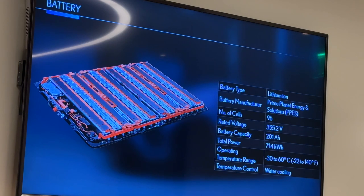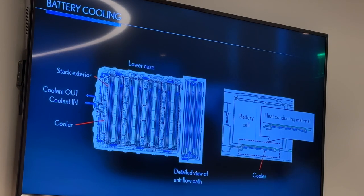A little bit about battery specs. We have a lithium-ion battery — 96 cells in 71.4 kilowatt hours. It's going to be not only water-cooled, but also have refrigerant lines — refrigerant and water-cooled through the case. That case is going to be bolted underneath the body, providing a significant increase in body rigidity, which leads to a very fun car to drive just from having that weight and rigidity on the bottom of the chassis, as well as exceptional cooling capabilities. With our battery management software and the cooling mechanisms built in, we're very confident about the life of our batteries. We've been building high-voltage batteries longer than anyone else on the road — if there's any concern about how we make our batteries, go to New York and get a cab: it's always going to be a hybrid system picking you up.